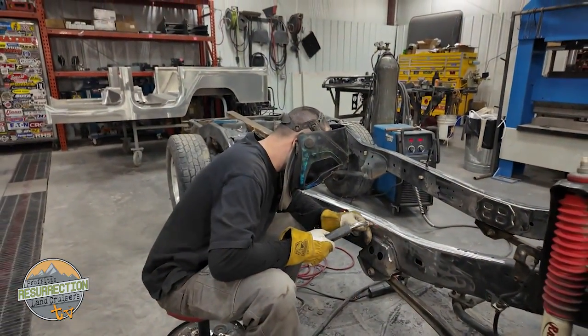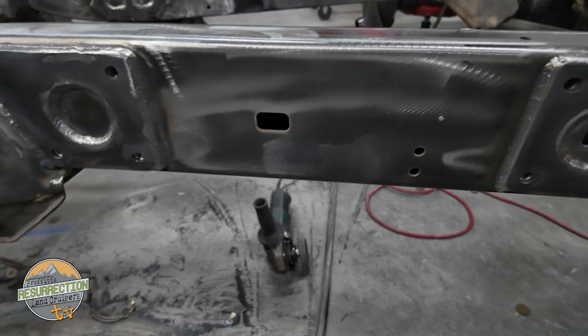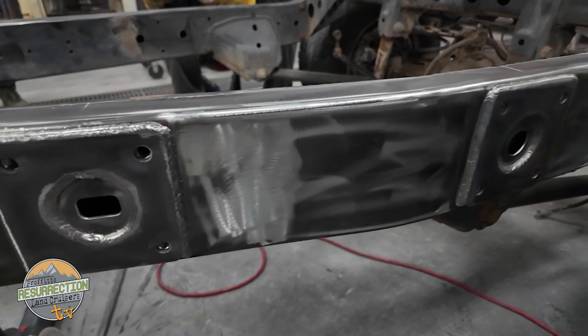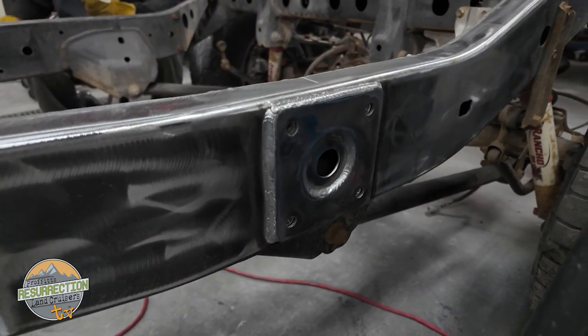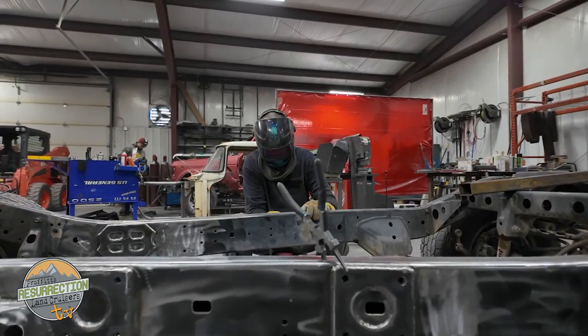So what do you get from an FJ80 chassis? You get a lot of stuff. You get much higher tech suspension than leaf springs. Coil suspension, front and rear, separate coils and shocks. A 3-link in the front with a high pinion axle that's a little bit wider and stronger than the 60 series axle. And then you get a 4-link, or some call it a 5-link, rear suspension. Also a nice cushy ride, coils and separate shocks.